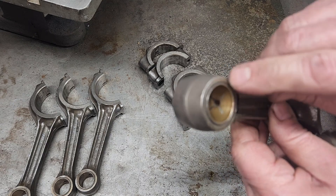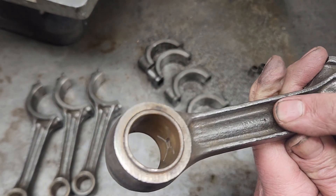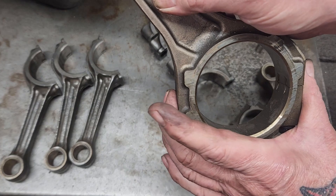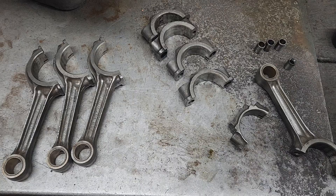This is an oil pressure fed pin. There's also a little hole in the side of the rod on both sides. That hole makes sure you get lots of oil in that cylinder so it smokes. This is the rod out of a 604 diesel — it's designed like that because it is big. Diesels have a lot more horsepower and torque than this little Triumph, which is only a 2.1 liter.